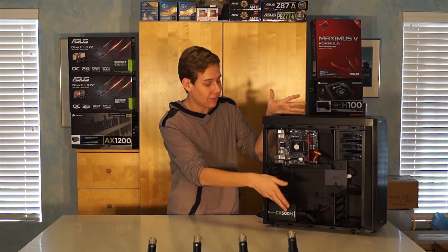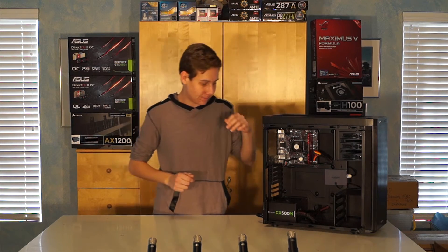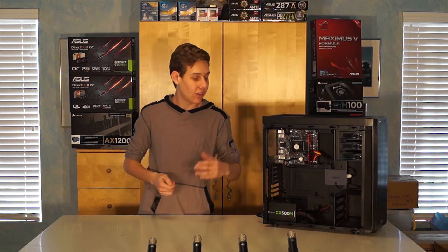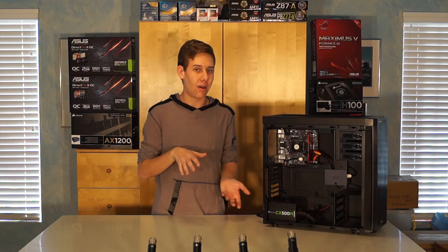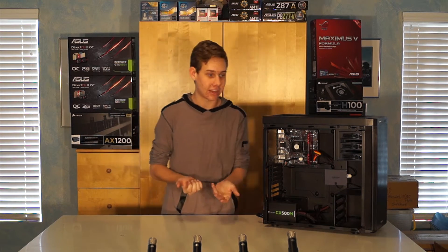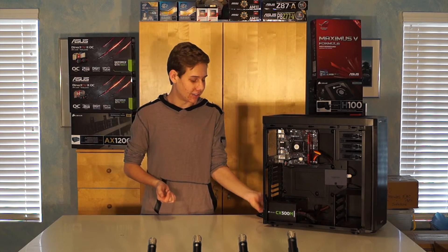There's ample room for everything I need. I didn't even use a single hard drive — nothing up top — and was able to put the SSD there, which is a kind of cool look. It's great to install Windows on, very fast from a flash drive — I'd recommend that over a CD, much faster. Using SSDs in it is the way to go; I would not recommend using a hard drive with this rig because it will bottleneck overall performance. It's very fast, small, and light — I can carry it with my pinky.